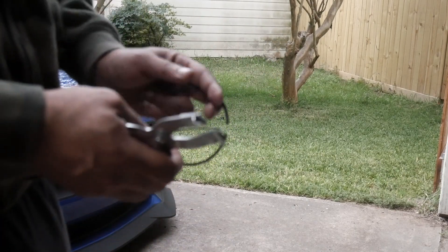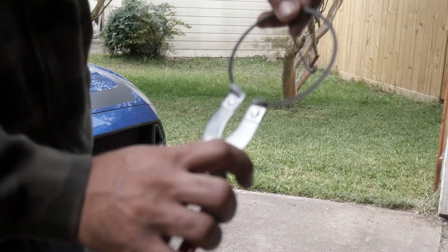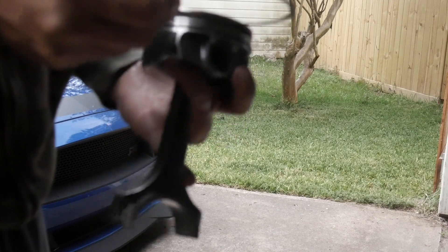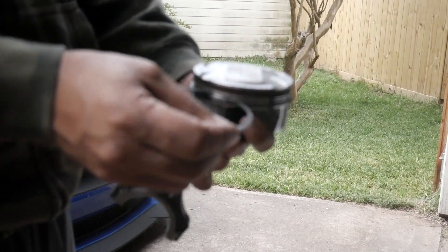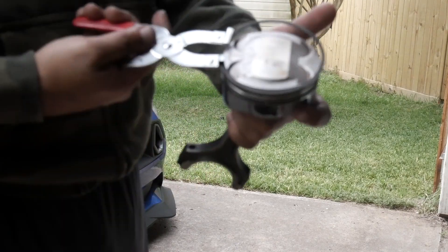They work pretty easy. All you have to do is slide your ring here into these little valleys and then slowly open it up and it separates it for you. Another thing I like to do that I saw somebody else do is I'll put the ring in to where it needs to go and I just kind of rotate it around where it's going to be going, to make sure that there's no snags, make sure there's no burrs that need to be filed down, anything like that. And we got a free rotation all the way around the piston. This one seems to be pretty good so let's go ahead and drop it in.